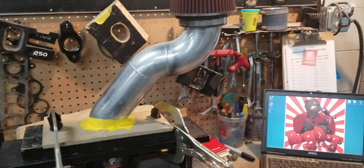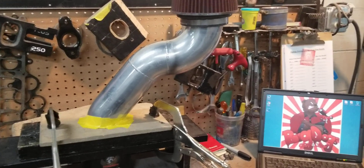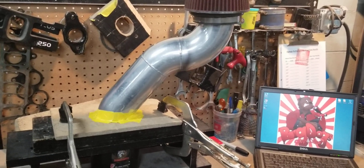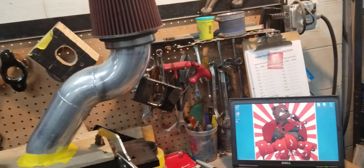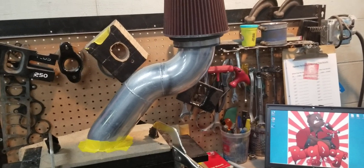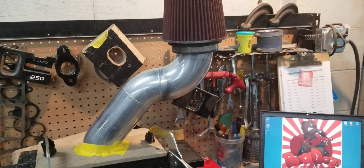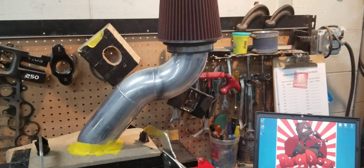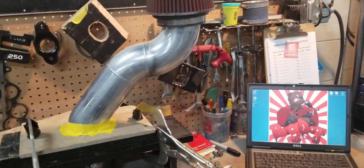He has a three and a half inch Anderson power pipe — the fender well version, not the engine compartment one — and although they support power and flow more than stock, they're actually a bottleneck when you start using our ported intake manifolds and our ported throttle bodies.